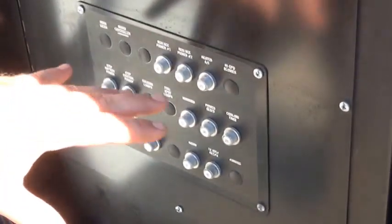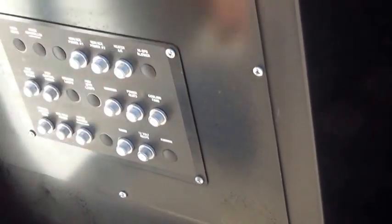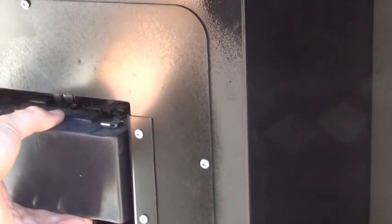And a little bit of storage and some more 12-volt breakers. So like our entry step, our awnings, and those kinds of things are going to be out here as well. So if something's not working, you can check a couple of these areas and see if there happens to be anything tripped. There are some chassis-related relays behind this cover. And then in this big hole area, that's where Winnebago and chassis all kind of connect, and it's full of wires.